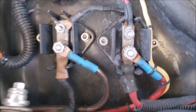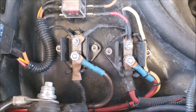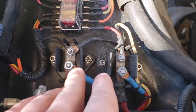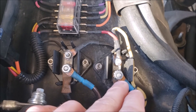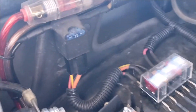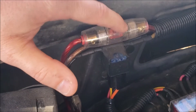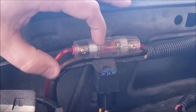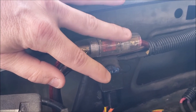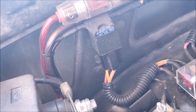I also added two connectors over here because I wanted an easy way to disconnect my battery but have really good thick battery leads. Plus, the closer to the battery, the less interference you get — which isn't a big deal for a fuel pump but can matter for some electronics and ignitions. That gives me a nice feature point for a good ground and a good hot. I've also got a stereo system with the JL Audio box wired in there, plus this fuse because my radio has a built-in 100-watt four-channel amp.